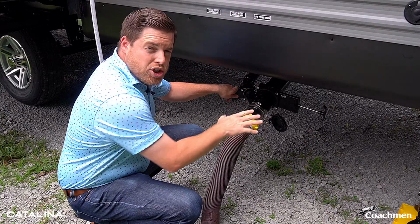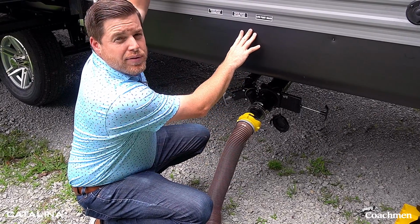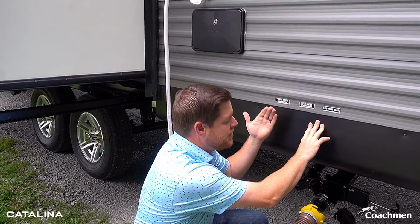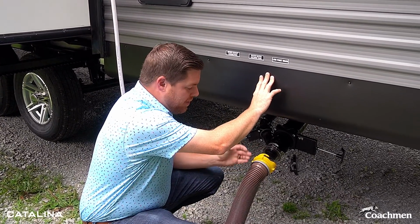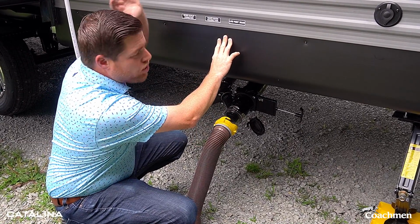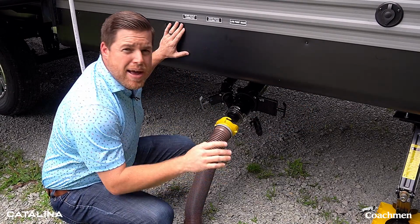flush valve. Once you pull that black tank flush valve, go and turn on the water for the black tank flush system. Once this is open, that way you're not filling your tank up through the black tank. Now, you just wait, let the black tank flush system do its work. You continue to watch it and monitor everything. Once you start to see the water run clear, you're good to go. Turn off the hose that's flushing through the black tank flush, close your black tank back up.